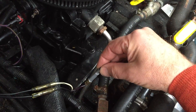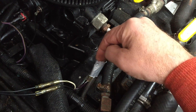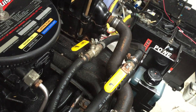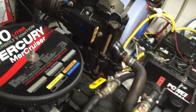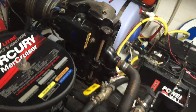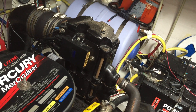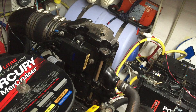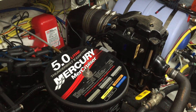There's a little lead there, the cap comes out the top, and you put a little lead with a plunger in there and earth it to one of the grounded points on the engine. Then the Denso gets taken out of the loop during the timing cycle while you're setting static timing. A pal of mine from Portugal came over and did that, and the engine has run absolutely sweetly since. Quite important if you've got one of these units.